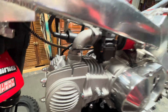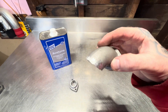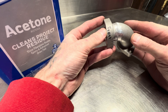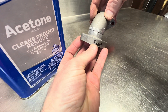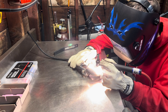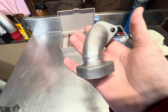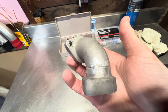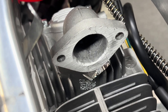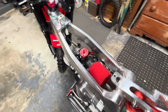I'm going to take it back off, do one more mark, clean it up, put it on the bench and do some tack welds, then put it in place. Got the intake manifold all cleaned up, filed down the edges nice and flush. Fresh off the welder — still a little hot. Did a tack on each side and it should be good. Also port matched both sides — to the carburetor and to the head — for optimal flow.